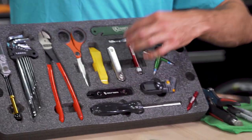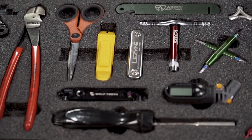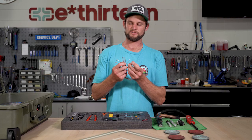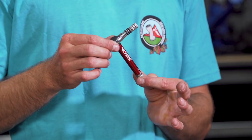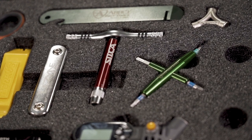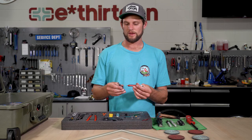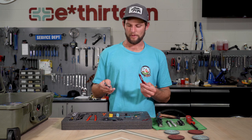Went with a straight rectangular cut all the way across. I have Baco scissors for cutting rim tape and whatever else. Tried and true Pedro's tire levers. Then we have the Lezyne hex block - I like that it has a lot of the smaller sizes and some 90-degree bends. Compact, nice, lightweight - it's been working great. I also have the Silca T-Handle, which is a ratcheting T-handle offering a torque spec of zero to eight - great for carbon bars. It's the most compact reliable torque wrench we could find. The handle comes off, it's all magnetic so you can get creative in tight spaces. There's also a piece without the torque setting if you want to tighten something down without throwing it out of calibration.